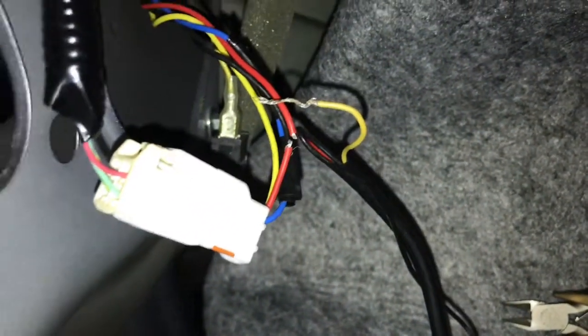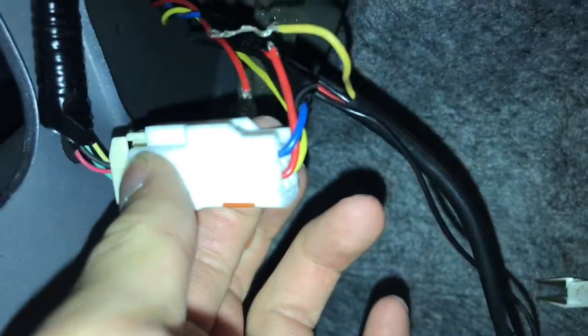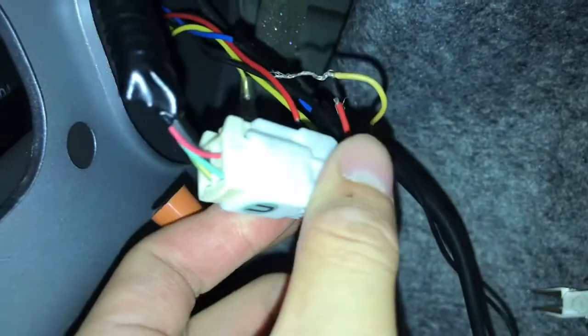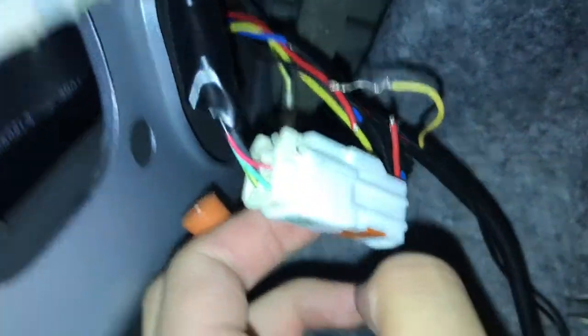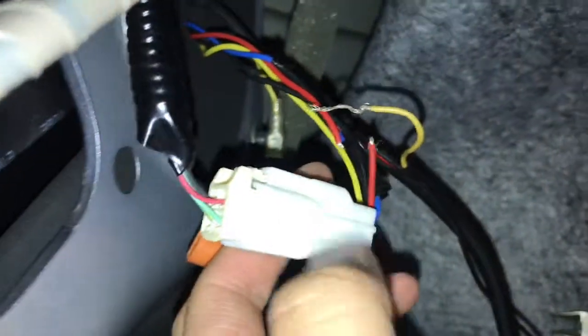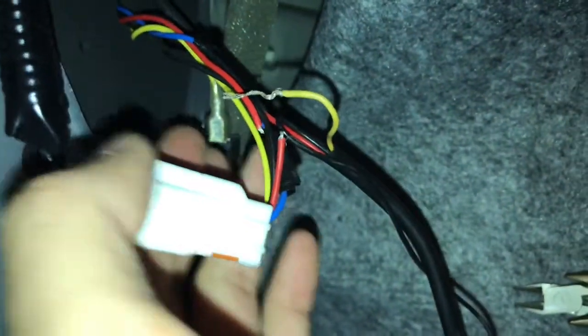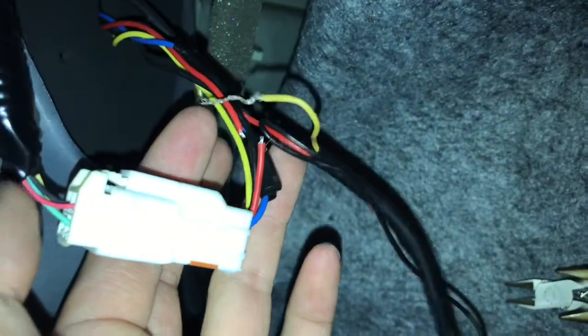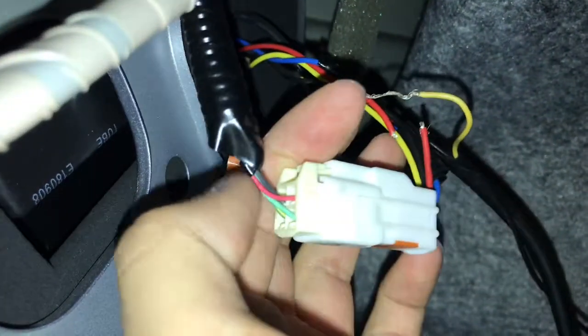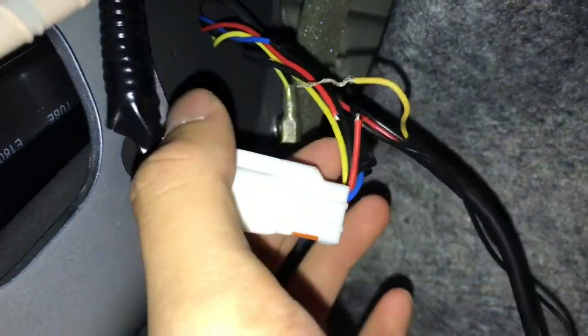This is actually a disclaimer — this is if you have Valenti's. If you don't have Valenti's, you can just see what the other red wire is connected to. It's going to be the bottom left, which is going to be the green wire on this side — that's the OEM stock side if you do have stock taillights. But I'm working on the Valenti side because it has more wire and more room to play with. As you can see the other side you can only work with a little while the Valenti side gives you all that wire.